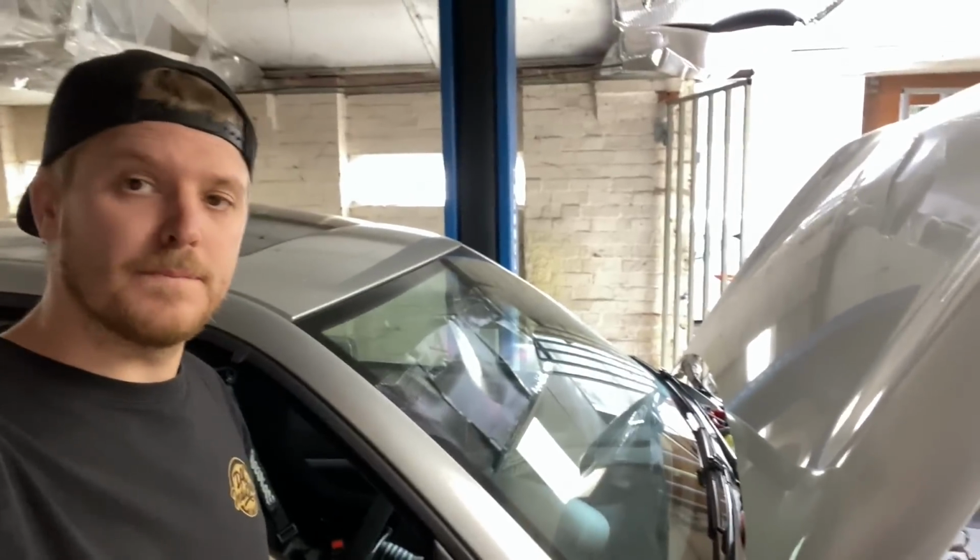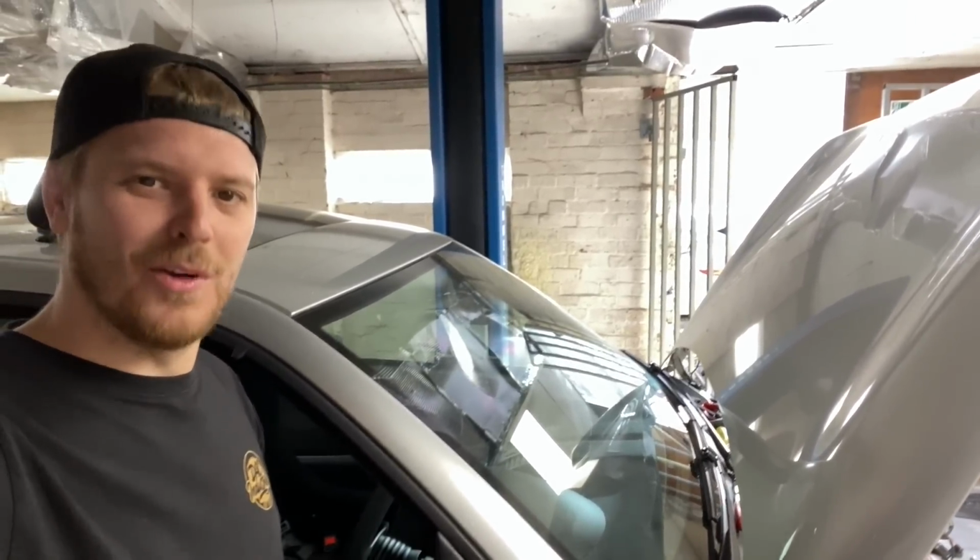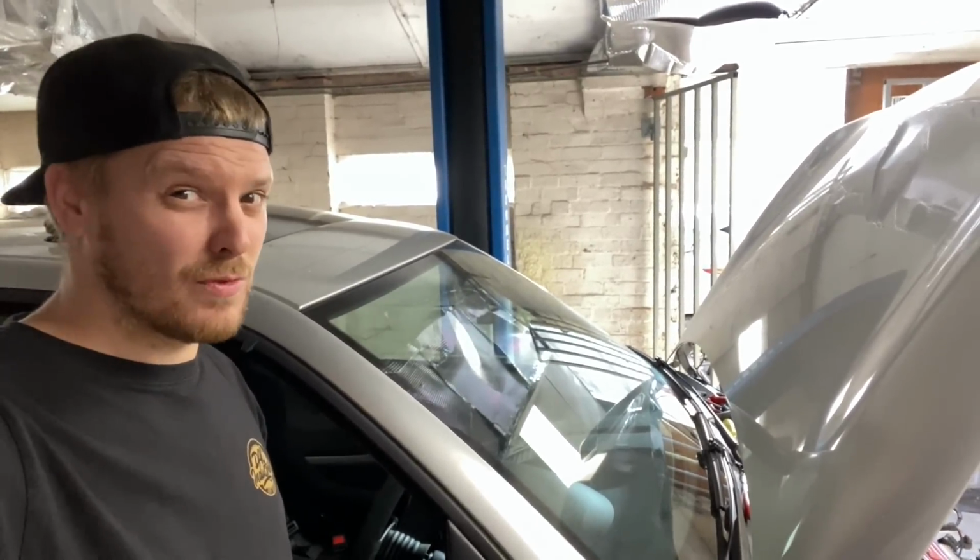We had all the plugs out, or all the HT leads off with plugs in on the head. We had a spark at every cylinder. I took all the side of the engine apart again just to make sure that my timing marks were still exactly where they needed to be and that they worked. And I'm happy to say, we'll keep walking around in circles around the ramp, but she runs. Sounds really quite nice as well.